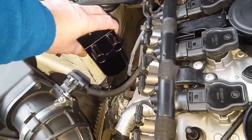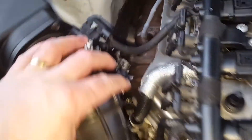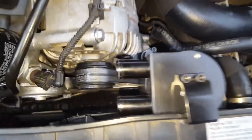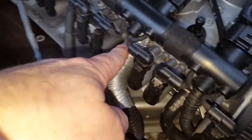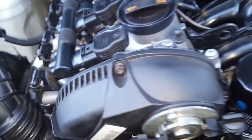For location, right here near the exhaust is not a good spot because the exhaust gets very hot — you want the catch can to have enough time to convert vapors to liquid. You'd rather mount it away from the heat. This location on the cool side of the engine is perfect. That's all I have to share about diameters and sizes. I don't think I need to explain how to connect the hoses — most of you already know how to do that. Thanks for watching, like and subscribe.